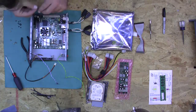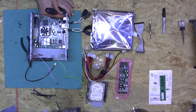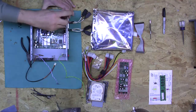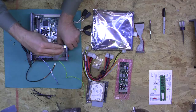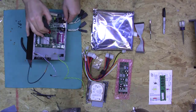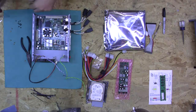This plastic plate holds the motherboard out an extra millimeter or so, so the first screw is a little tricky. Find something sturdy on the board — I'm going to use this PCI slot to help hold it in place and help everything line up. You can use a magnetic screwdriver; this one happens to be non-magnetic. The first one's the hardest just because of the pressure to align the holes. I'm going to use this printer port now to align this hole. One important thing when pushing on the back of these ports is there are a bunch of pins here, and you really don't want to push on them — they're sensitive. So find something rigid to push on, like the plastic that's actually attached to the motherboard, in order to align the holes.